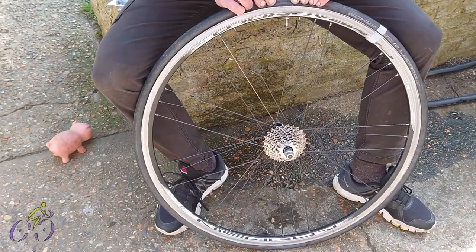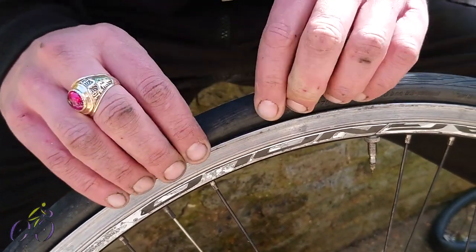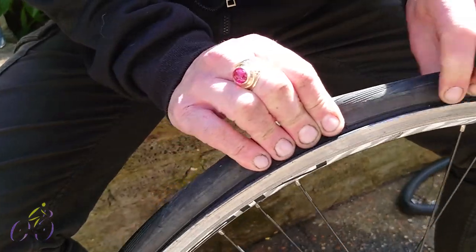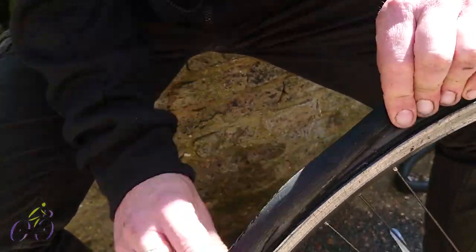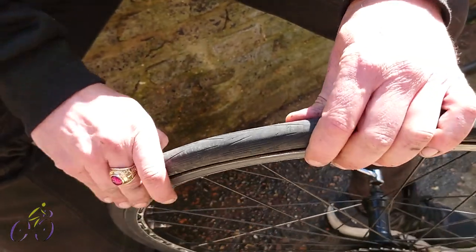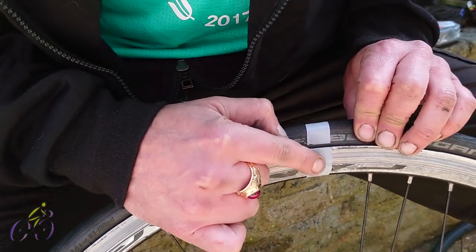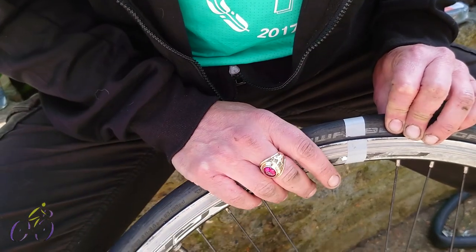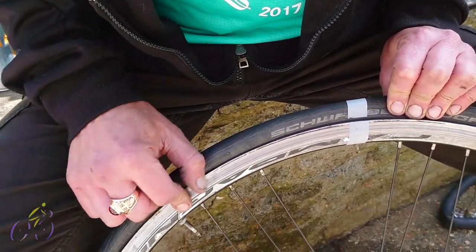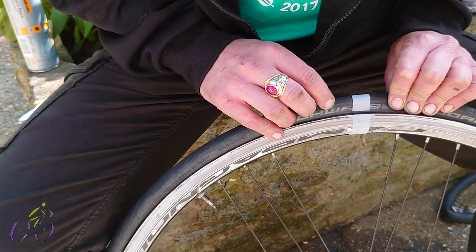If you look at the depth of this wheel, you'll notice it's slightly deeper than a lot of wheels, and therefore you may need to buy a slightly longer valve stem in a tube. Some of the nicer tubes tell you what size they are. The first thing you want to do is make sure the tyre itself is pulled away from the rim. When these are pumped up at a very high poundage, they can stick to the rim sometimes — and that goes for all tyres. A little tip: I've put a piece of tape marking the place where the tyre sat. This helps you locate the puncture, particularly if you're going to repair it, and lets you check the tyre for any bits of glass or tacks that caused the puncture.